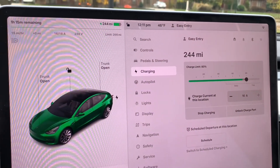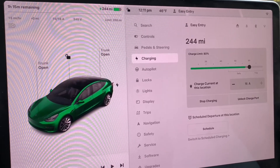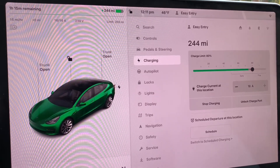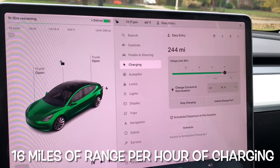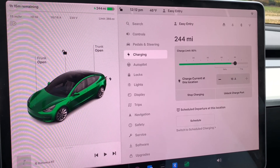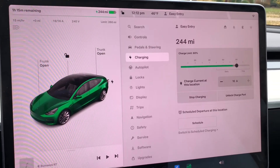As you can see, we're charging now at 16 amps, which is 80 percent of the 220/20-amp circuit. We're getting about 15 miles of range. When I first did this yesterday, I was getting a little bit higher voltage and was actually charging at about 16 miles of range. I really feel in most cases this is going to be adequate for most people.